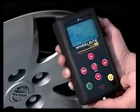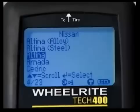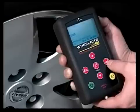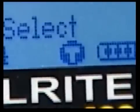Now select the model by using the arrow keys and hit Enter once you've reached the desired model. Finally, select the year using the same up and down keys. If the letter T appears in the icon display under the menu before you've reached the model or year, the Tech 400 is telling you that no further selections are required for that vehicle.